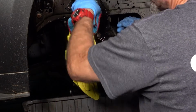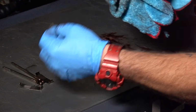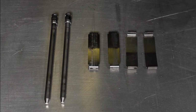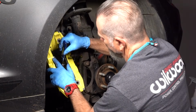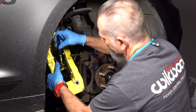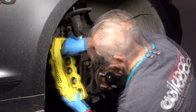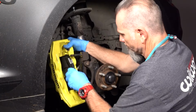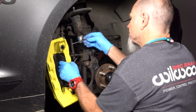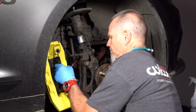Wipe dry when done. Use your cleaning solution on the pad retaining pins and wear clips. If any parts need replacing, now is a good time. At this point, when everything is clean and dry, push the pistons back into the caliper. Reinstall newly purchased or clean and dry wear clips into the caliper and wipe the backing plate of the brake pads clean as well, being careful to keep the pad friction material clean and dry from any contaminations. Here, we are installing brand new brake pads.